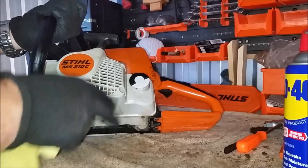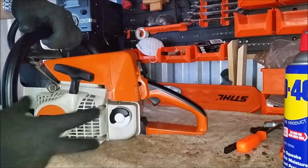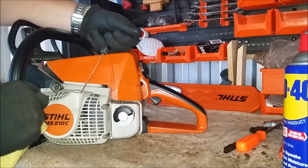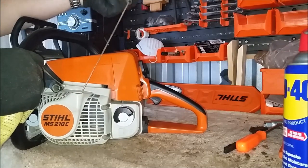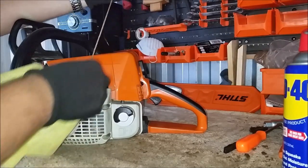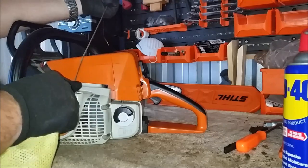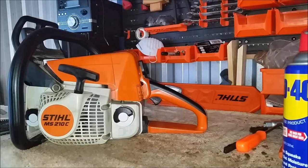I'm going to check the recoil side. Make sure that's nice and clean and there's nothing built up in the intake blades here, because that's where the engine draws its air from — you want it getting the cleanest air possible. It's a good idea to check your starter rope with the engine off — check its full length and make sure it's not frayed or damaged. This is the easy start, and it's a nice thin rope on this one. Just make sure it's nice and unfrayed and undamaged, and strong — because it really sucks to have your starter rope break when you're out in the field.